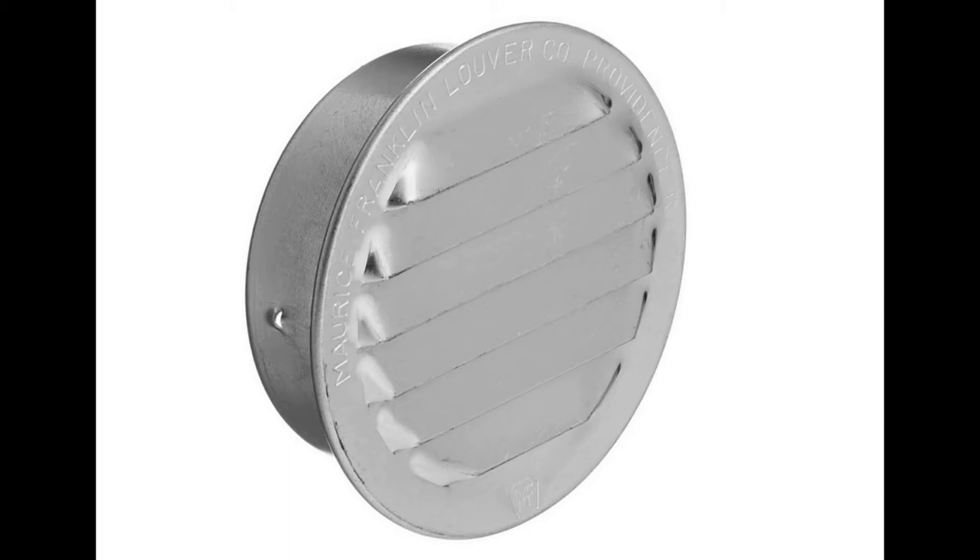The Bugout trailers are pretty airtight once you put the canvas and the foam and the glue and everything together. The doors seal really well and the windows seal really well, so it is a very good idea to put vents in your Bugout build. In my last Bugout build these are the vents I chose to use. I painted them black and put four of them, two on each opposing wall, and they seem to work quite well. The only problem is you don't have any way to open or close them, but again we're trying to keep ourselves alive. So this is one option to vent the trailer.